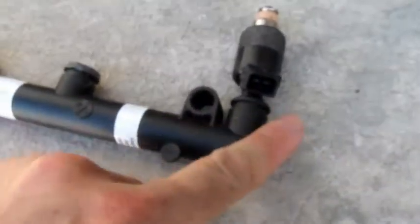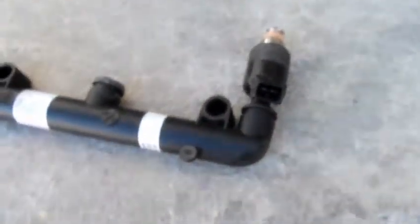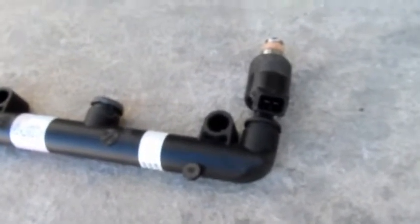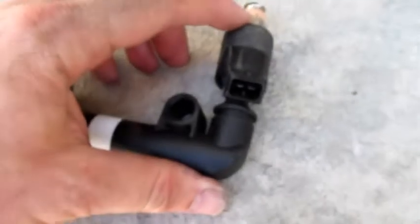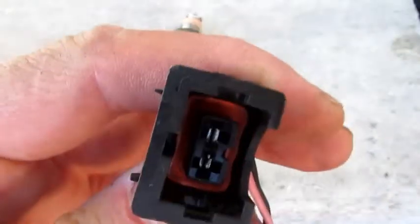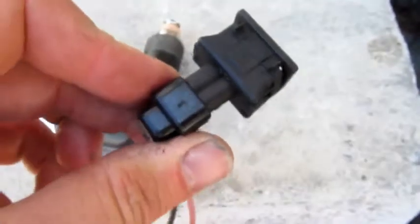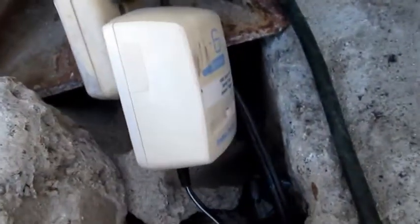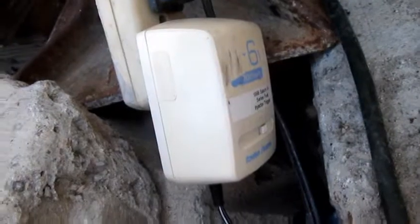The way it works is you put some liquid in here — like a cleaner, carburetor cleaner, whatever — about half an ounce or a little less. Plug your injector in, then go ahead and plug in this stub which came from the junkyard. I clipped it and did a little soldering. There's a lot of talk about the voltage, but you only need a little bit to trigger it. In this case, it's just a standard universal 6-volt power supply. Polarity doesn't seem to matter, so either way.